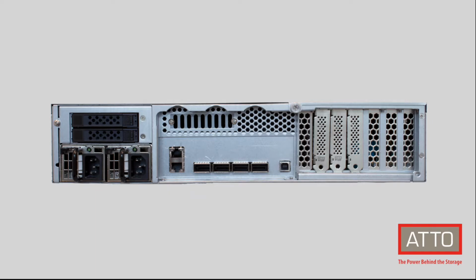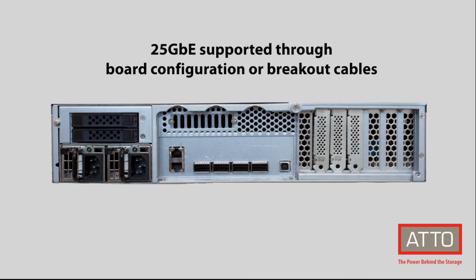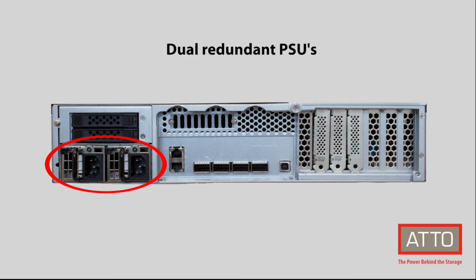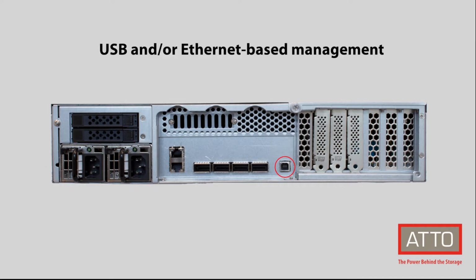Depending on the storage architecture you'd like to build, we can offer 25 gigabit Ethernet options as well. We are also able to support more Ethernet ports through breakout cables or board configuration if that's desirable. The controller supports dual redundant power supplies, and management is accomplished locally via a USB or remotely through one of the 2 Ethernet management ports provided.